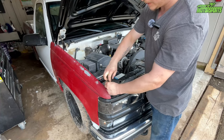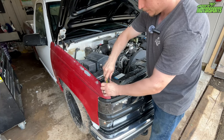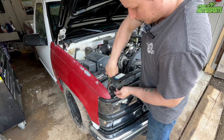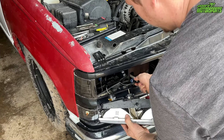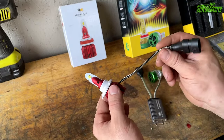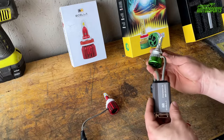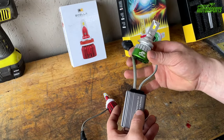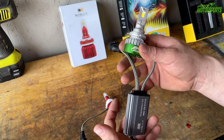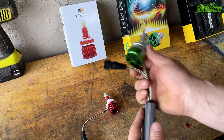If you didn't see the previous video of me putting these LEDs in, these headlights are super easy to take out. There are two Phillips head screws. Once you get those screws out, it just slides right out, and the bulb pulls straight out. Undo the connector and get the bulb out. The Bullet B1 bright does not have a ballast — my low beams have a ballast, but not the brights. I specifically wanted these for the brights so that when I turn the brights on to see deer, I've got as much light as possible.